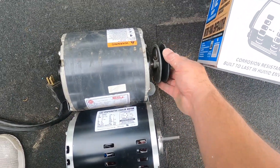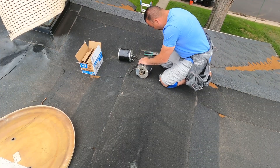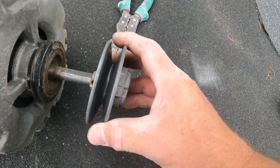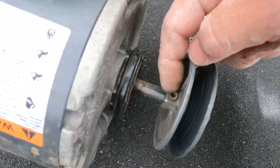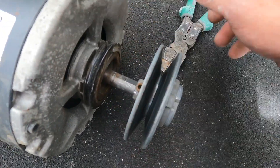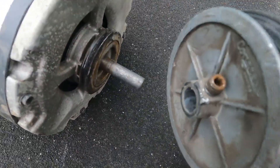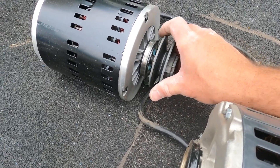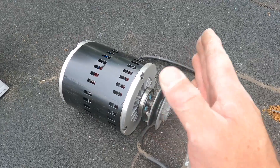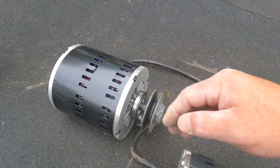What we need to do now is make sure that the pulley comes off — get your Allen wrench key, then we're going to take this pulley and put it on the new one. You only need to unscrew the inside Allen wrench nut; there are two, but just do the inside one. If you have a large screwdriver or a pry bar, just tap it along so it pops off. Pretty simple. Now we're going to put it on the new motor. You want to try to line this up just right after you set the belt, because you don't want it to be too crooked or cockeyed. Put the motor back in and then set it in place to make sure the belt is nice and even with the fan.